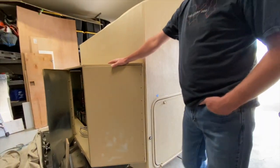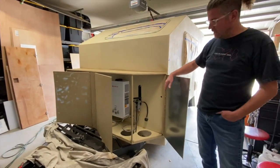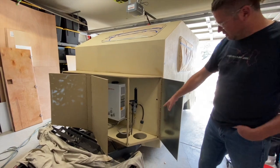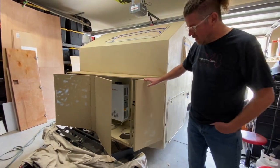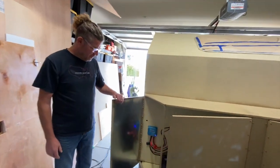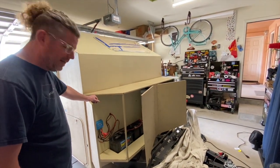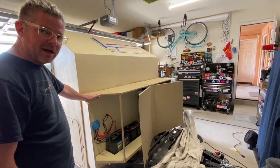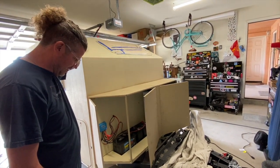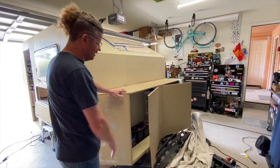LEDs are wonderful. They've added this box at the front that was framed before, with a couple doors that open. On this side it's got the water heater and the propane - still need to add some dividers to keep fumes and things separated. There's the two propane tanks, regulator, and water heater. On the other side there are a couple batteries and the excellent Victron solar controller with two 100-watt panels on the top. We're using flooded batteries for now because they're cost effective - eventually maybe we'll upgrade to AGMs or possibly lithiums, but for now it's the $85 Walmart batteries.